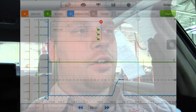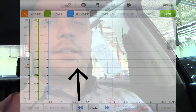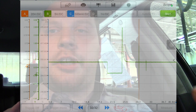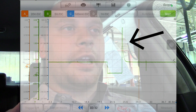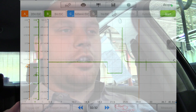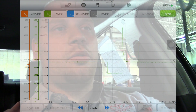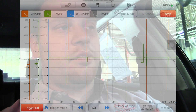On the green trace, I have 12 volts going through the fuse, through the windings, into the ground side. When the ground closes, current builds through the windings and creates a magnetic field. When that ground path opens, the magnetic field collapses back onto the windings, which creates that huge voltage spike. I'm using a 20-to-1 attenuator so the voltages aren't accurate, but you can see the fuel injector is firing and you can also see the pintle hump, showing that the pintle is closing.